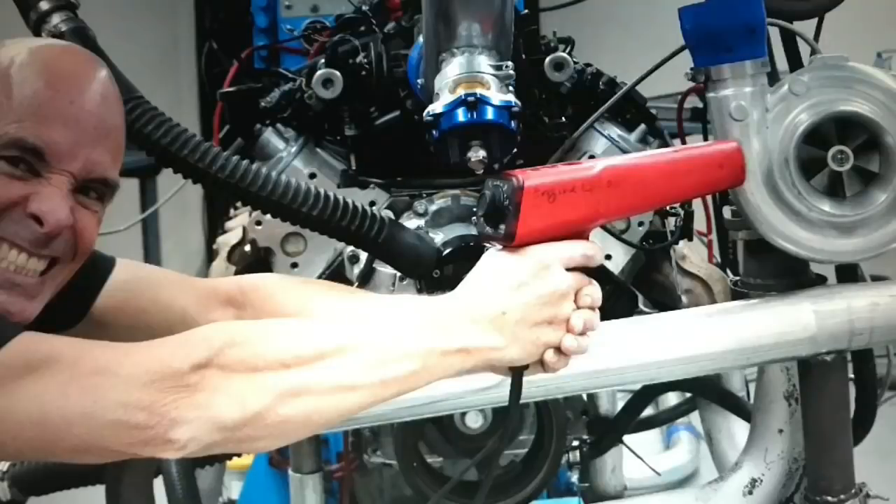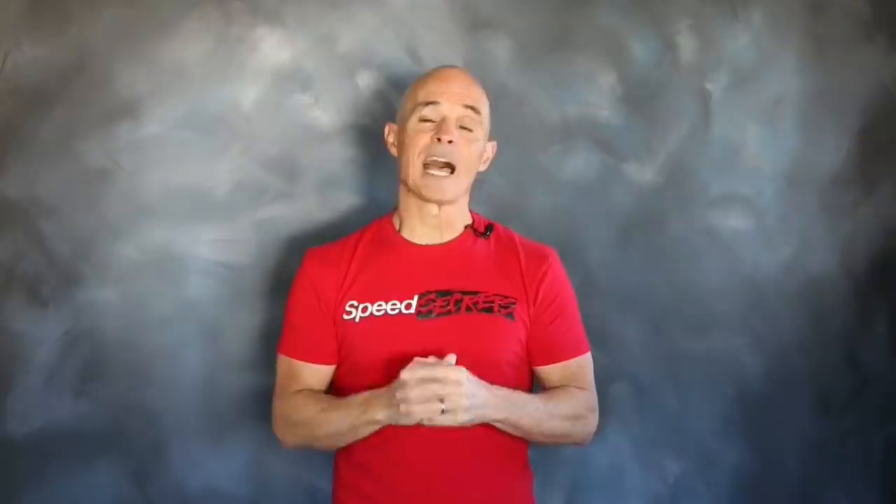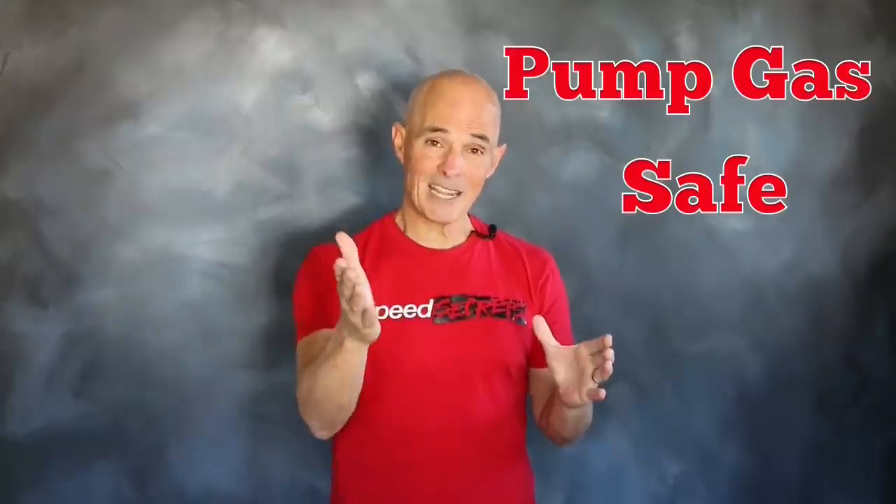The way that I ran this test, I installed E85. Then we varied the timing from 20 degrees to 18, to 16, to 14, and finally down to 12 degrees. The reason I did this is I know 20 degrees is a good timing level for E85 with a turbo, and 12 degrees of timing is a reasonable amount for pump gas and it's safe. This test isn't about maximizing the power output — it's about showing the big difference between a pump gas tune and a race gas tune, and that's primarily timing.